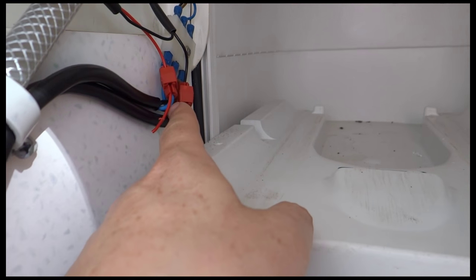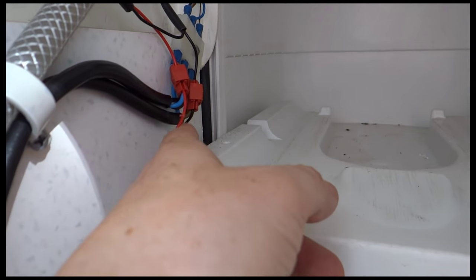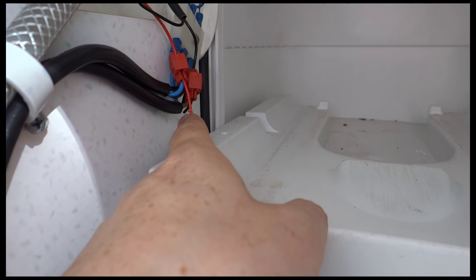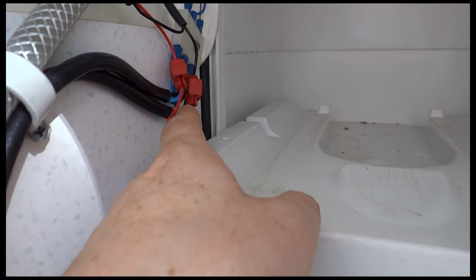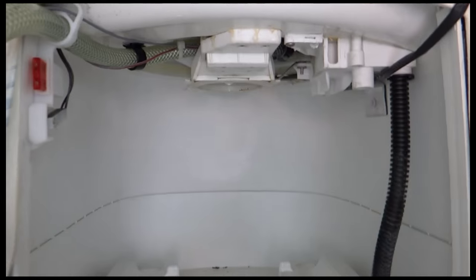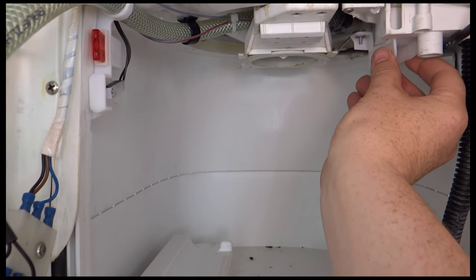Still didn't work, so I popped the multimeter on there and found that the brown and blue colours are the wrong way around on the van. So you can see now I've got the red connected to the blue. And to be fair, in the instructions it does say to check the polarities are right, and I didn't do it, so I've done it now. And if I just open the little thing up there, you can hear the fan going. We can hear it.